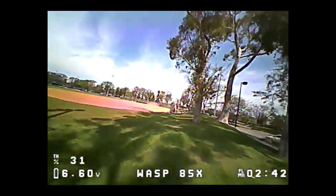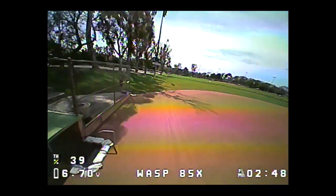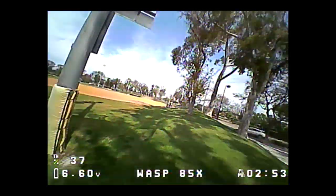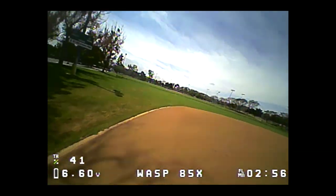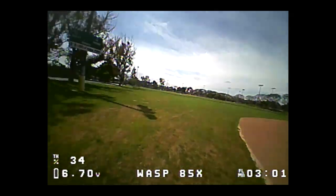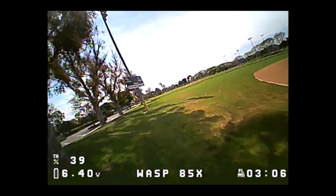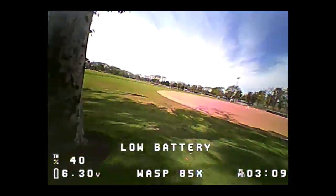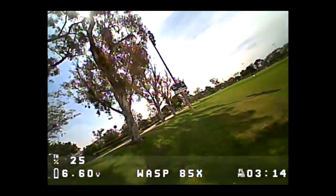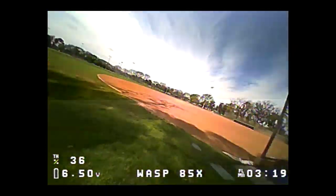When I'm just cruising around, the voltage does recover. It's still pretty low at about 3 minutes. When the voltage sags below 7 volts, it doesn't seem to have a lot of oomph — not much get-go. It just does not want to move too well. It moves, but it feels more like a whoop now. Just to give a different feel with a different battery, but it doesn't seem to be all that much better.